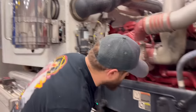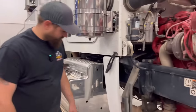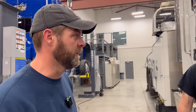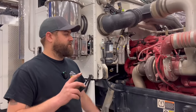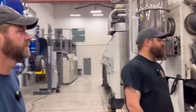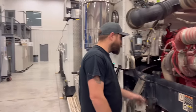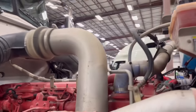We've got a coolant smell. Before we get into the engine, we're going to work our way around the chassis. I did have to put some coolant in it before I left the house — we topped it off, so it's either using it or losing it. The turbo VGT vanes are making a noise. If we pull the upper EGR pipe we can check it, but we'll wait for the engine to cool down and do everything else first. Lake's almost got the whiteboard put together.